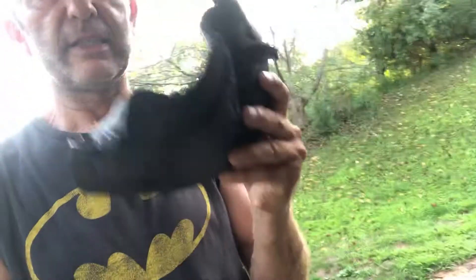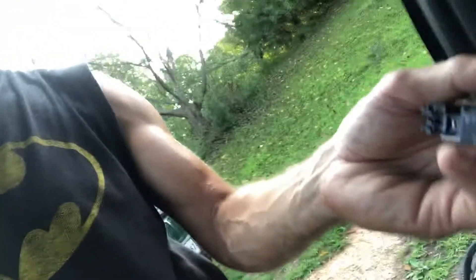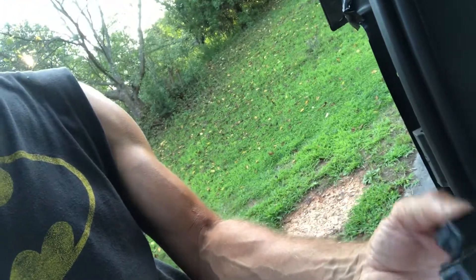The relays were wrapped in foam, just like this. When I took this out, it was completely damp — soaked — and there was also water present. So the relays were completely damp and that was my problem. As soon as I disconnected all three relays, my brake lights turned off. That fixed everything.